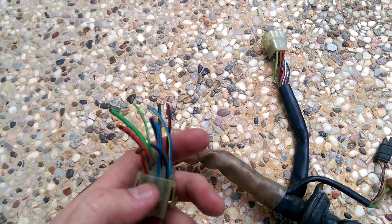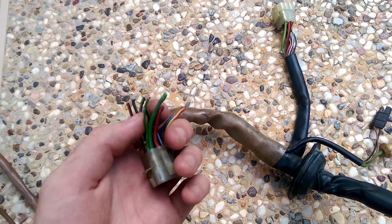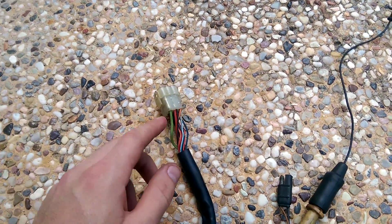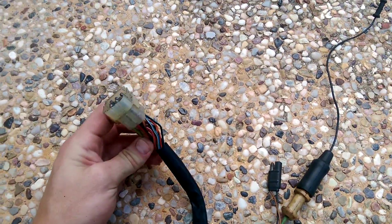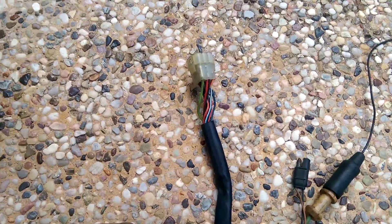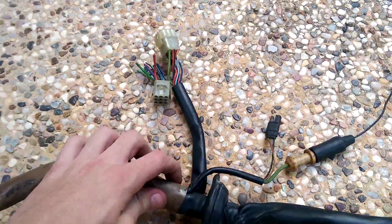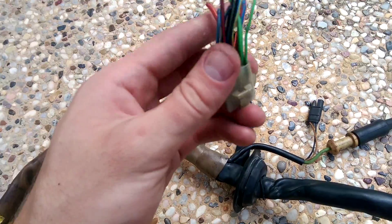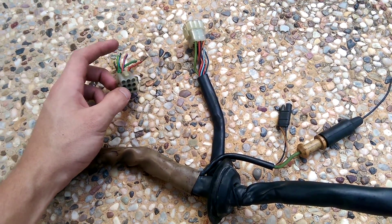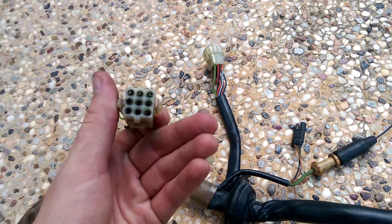The last intricacy I think is interesting is that on the car side there are two green wires coming out of this coil ground. The DME grounds the ignition coil to fire it every firing event — it initiates that ground, sinks it, grounds this pin, which in the car then grounds the next one and goes to the coil. So there was no connection on this entire harness going to the ignition coil directly — it actually goes to the coil through this connector. The interesting thing is there's a second, thinner green wire, and that actually goes to the tachometer cluster. I'm not sure what it does — it might be for the shift light. There is a green wire that goes into the back of the tach connector, but it is not for the tach signal; it's for something else.